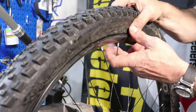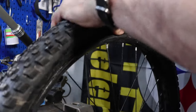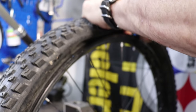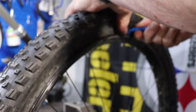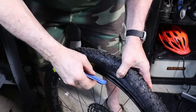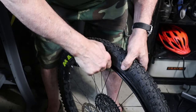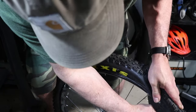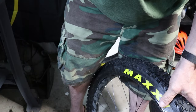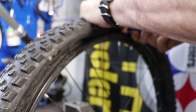Here's where we find out how hard it actually is to break the bead on these now. They claim it's not easy. I've watched videos with other people who used other brands, and they said it is either tricky or impossible to remove the tire after these inserts are installed — one guy even said that he had to cut the tire off. I'm gonna stick a tire lever down in and try to break it. It really wasn't that bad, but all you have to do is use tire levers and some soapy water on the bead. Use extra care so you don't damage the bead when using tire levers.